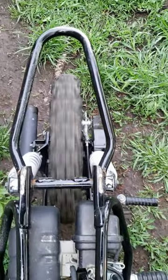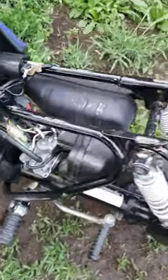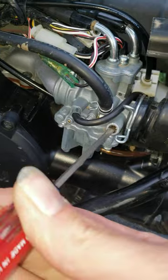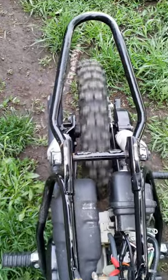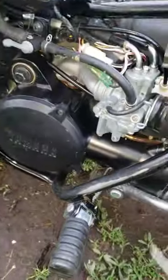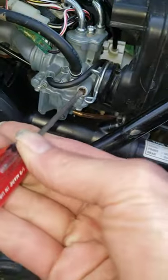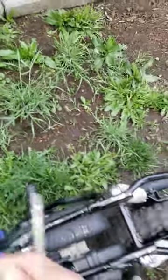See the little poofs of smoke and the cutting out. We'll go back to one and a half out — this is where this bike was at the factory. It tried to run but was still stumbling. So now I'm going to give it a quarter more — just a quarter more. This is where I found it's running good.